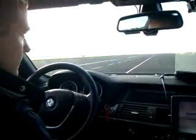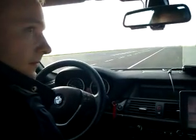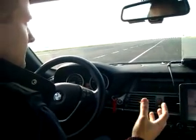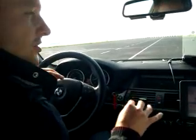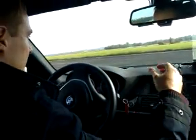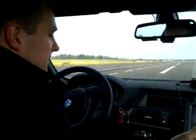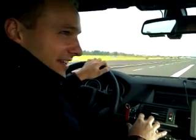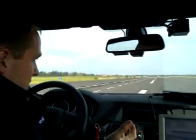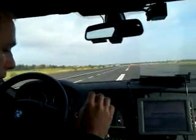But why is the system braking in the last moment? It maybe could be more comfortable if you start braking early. But it's not a comfort system. It is a system that helps the driver in very bad emergency situations, and it's not a system that should be used by the driver to, for example, stop his car in front of another car. So it's an emergency system that in the best case the driver will never experience the braking, only if he's in real danger. But actually in the development there's one big challenge, and this challenge is that the driver can not only brake, he can also overtake the car. And this overtaking is possible after the point where we already have to brake.